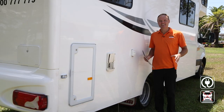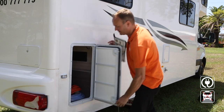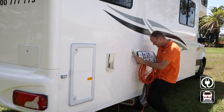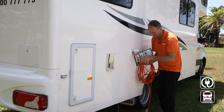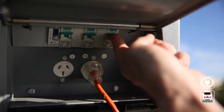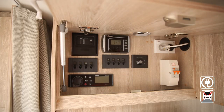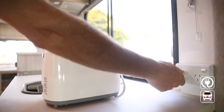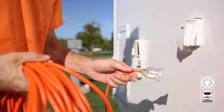Connecting your RV to campground power: first you'll need your extension lead from the storage compartment. Insert it into the RV, making sure you get a nice connection with the large earth pin at the bottom. Insert the lead into the campsite outlet and turn on. All paid campgrounds will have 15-amp outlets with the large earth pin. Make sure the circuit breaker is in the on position. Turn off all appliances prior to disconnecting, and disconnect and store the lead before moving your RV.